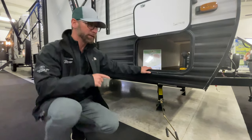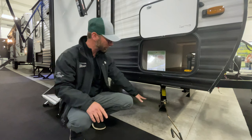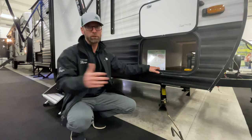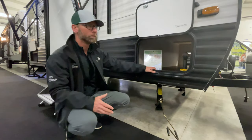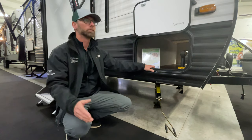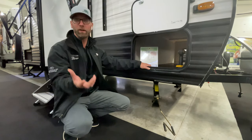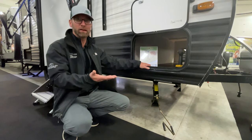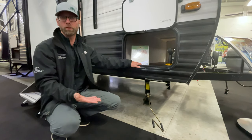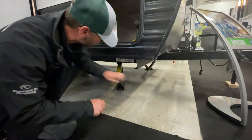You'll want to purchase some plastic support blocks — you always want something between the bottom of the jack and the ground for settling. We sell those at our service facility, and service facilities at campgrounds across the US offer them too. You can also use wood blocks. You don't want these jacks to settle into a grassy or gravelly area. Pavement gets hot in summer and they'll sink in; on concrete they can slide. It's good to have something between the jack and whatever surface you're stabilizing on.